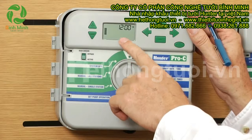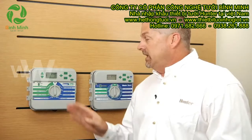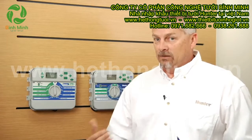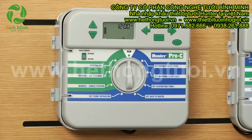That tells you that you have done the reset procedure correctly and you're all set to reprogram it. If you get any other time besides 12, try it again — you didn't quite get it the first time. It may take a couple of times, but you do want to show 12 o'clock in the display.